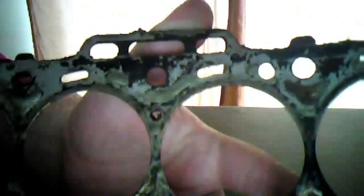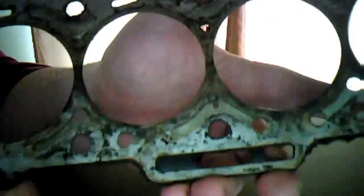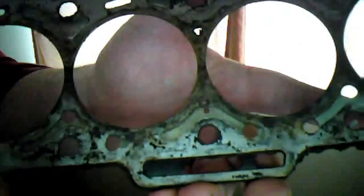Not only here, but also continuing, we have some leaking here as well, and not so much in the middle. So we can definitely tell that this was leaking. There's no problem with the head or the block — we're going to have the head reconditioned and make sure the block is sufficiently prepped. But this was just a failing head gasket due to wear and tear over the years. Since it is a vehicle from 1984, I'm not that concerned, because it's done its job for so long.